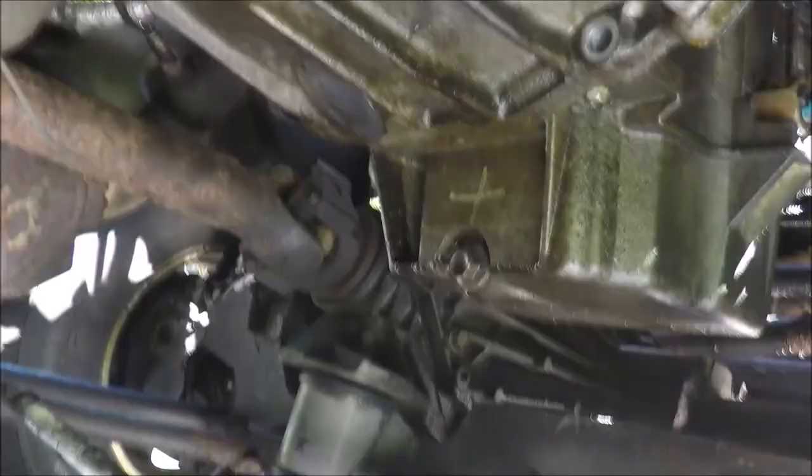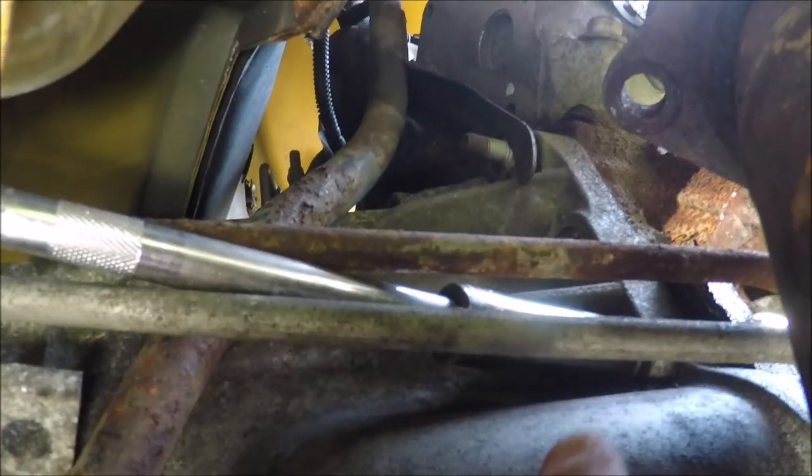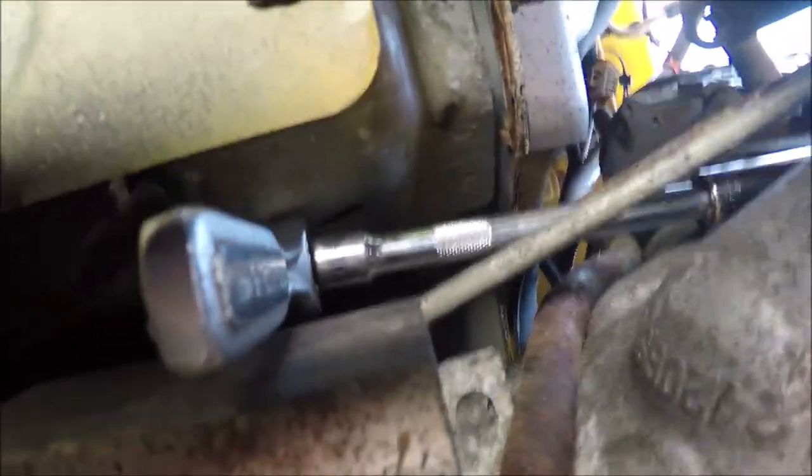Okay, we're under the vehicle, from the tranny to the motor. One of the worst bolts to get out is going to be on the passenger side. There's the first big one. Second one up. You're gonna have your two tranny lines running here. There's the bolt inside there. Hopefully, if you're doing this, you'll know exactly what I'm talking about. I found the best way is to disconnect these tranny lines down here on the motor, split the lines up top here, use a 6-inch adapter on a 15 mil deep socket, and get your wrench up here, right between the cat and the tranny, pretty much.